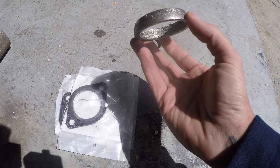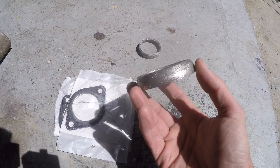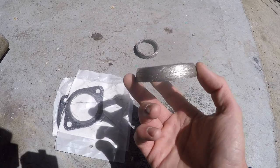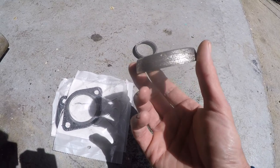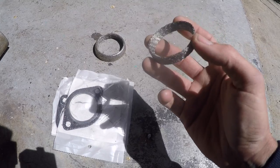The first is a lead donut. This normally fits right up into the header, and then the exhaust pipe itself smushes it into the header. These are good for when the motor has soft mounts and the exhaust itself is more of a solid mount — this will allow some flex, and as it heats up the lead will conform to the header flange and seal off your exhaust.